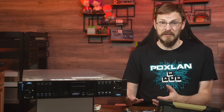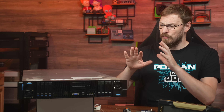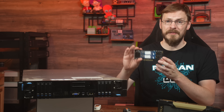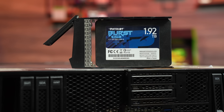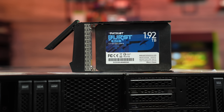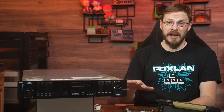On top of AI, I'm also interested in seeing how it would run as a cloud gaming server. The NVIDIA V100 is still an insanely powerful GPU today, and with eight physical GPUs each with 32 gigabytes of memory, we might be able to run 16 cloud gaming hosts off of this one server. For storage, I've got a pair of Intel 16-gigabyte Optane drives for the OS, as well as eight 1.92-terabyte SATA SSDs for my ZFS array. For networking, there are four 10-gigabit SFP+ ports built in, plus a dual 25-gigabit network card I added for good measure.